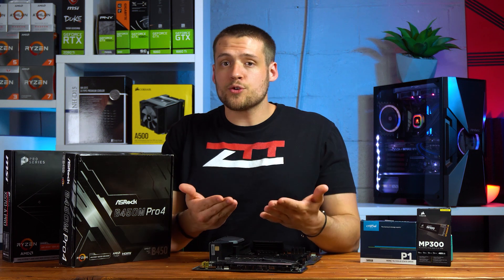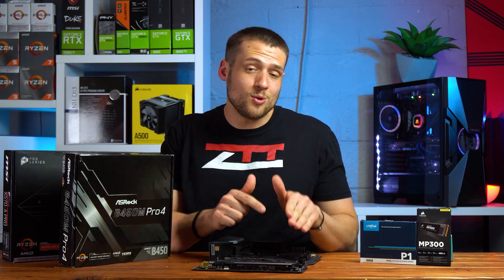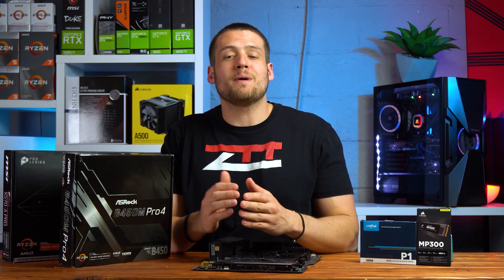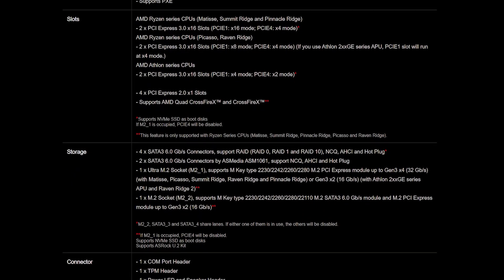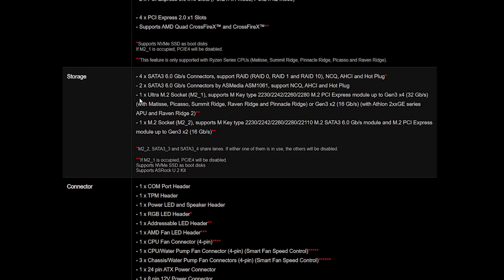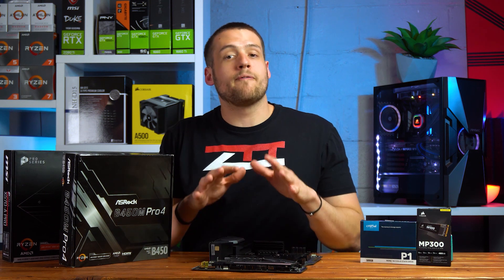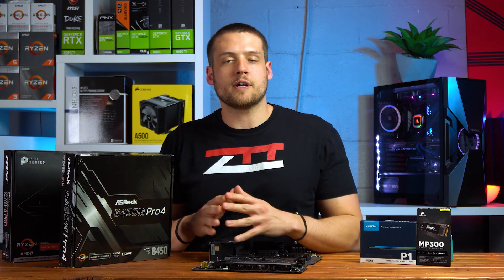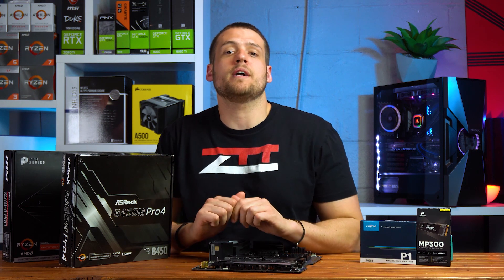Just like sizing, this is super important. If your motherboard — or especially a laptop — only has an M.2 X2 slot, you don't want to waste money on an X4 drive because you'll be bottlenecked. Even worse than bottlenecking: some motherboard M.2 slots only support NVMe drives and not SATA drives, so if you buy an M.2 SATA drive, your motherboard won't recognize it at all. Before you start buying and building, really look at that motherboard spec sheet to find out exactly what speed and size M.2 drives it will take.